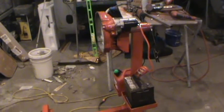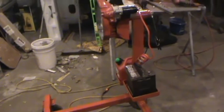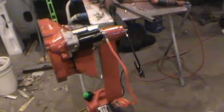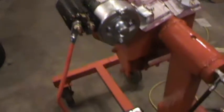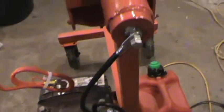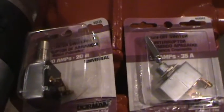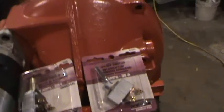I don't know if this is part two — I think this is part three of the engine run test stand. I got the bell housing welded on, welded onto the stand. I got the starter on, battery cables, ground cable, gas tank in place, battery in place. What's left: here's the push button starter switch and then like an ignition switch, so I got to make a little control panel.